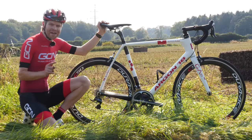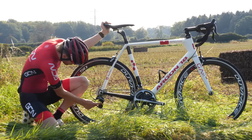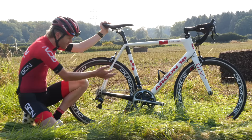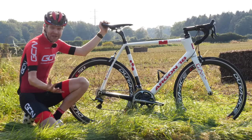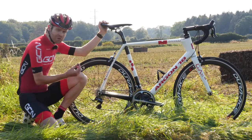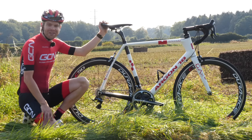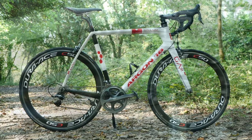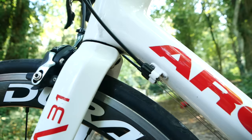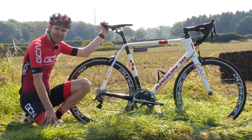In other areas, the old Dura-Ace does still have the edge though. So you've got really high quality materials used throughout. Things like carbon fiber on the cage of the rear derailleur and use of titanium alloys. Also, more sophisticated machining and shaping of the components. More expensive and higher quality bearings are used throughout. And there's also surface finishes on things like the chain and the jockey wheels to help reduce friction. And looks are subjective, but I think it looks absolutely superb. I love the aesthetics of this generation of Dura-Ace. And I also love that it's got kind of nostalgia attached to it. The fact that it was used by so many pros for so many incredible victories back in the day. And for me, that kind of makes it a little bit special.